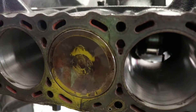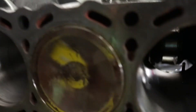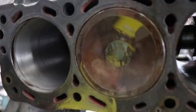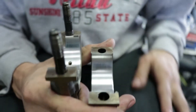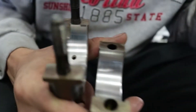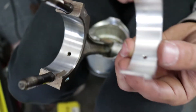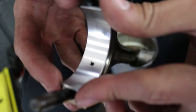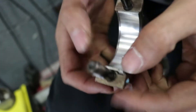This is cylinder three, piston number three — they're actually numbered. This is TDC, which is top dead center, and BDC, which is bottom dead center. About the bearings: just to make sure they're good, you hit them with a little bit of assembly spray, have it looking clean, and then put it in. As we're putting the bearings on, you do have to match it up with the rod journal, because that's what the oil seeps through. That is very important — you cannot mess that up.